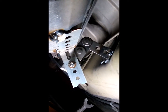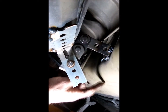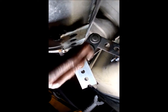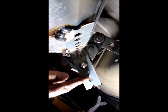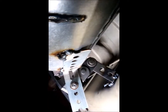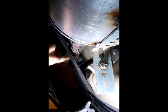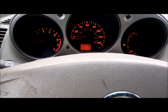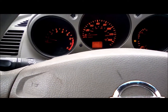It's not real beautiful - had a heck of a time welding this thing and got paint on the car. I got one of these universal brackets from NAPA and made a 90-degree bend, welded it to the body. I wanted it to hang vertical but it didn't quite work out. I left it long because I wasn't sure if I'd have to push the muffler up higher - wanted extra adjustment room. The big thing on this car is there's a cross member with real tight clearance, about a finger's width. That's why I put the hanger here, because it was hanging down and would hit that and rattle like crazy.